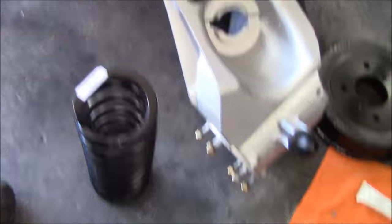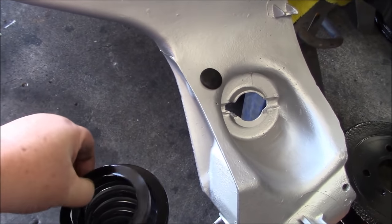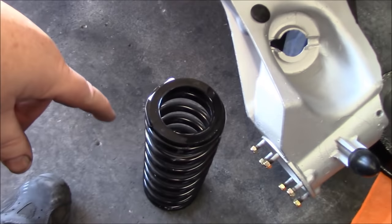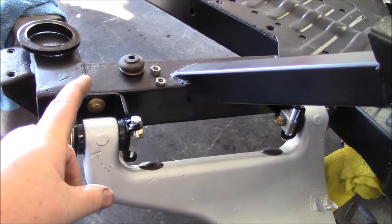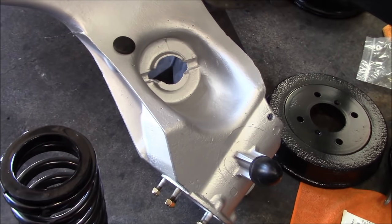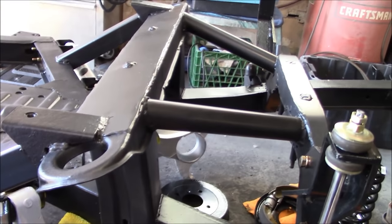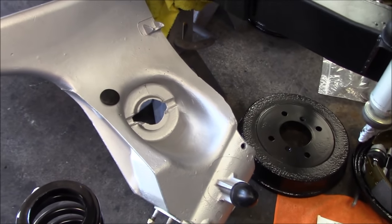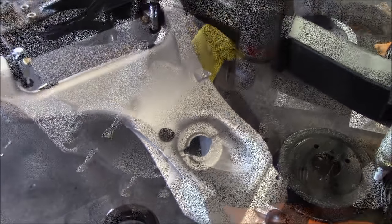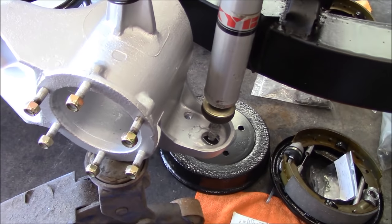Just about ready to install the tube shock onto the trailing arm. We've got the Good Parts rear spring, the poly spring packings for the rear — they're tagged rear and seem a little smaller than the front ones. We've got the poly packings, the bottom shock mount ready to go, anti-seize on the threads. We're going to use a floor jack to try to lift the trailing arm. As I suspected, without any weight on the rear of the car, that's about as far as I can get the spring compressed before it wants to lift the frame off the jack stand. We're going to have to wait for Les to provide some weight.